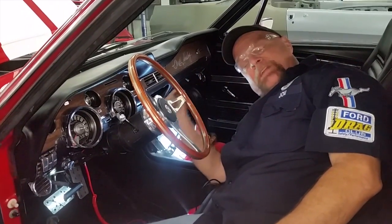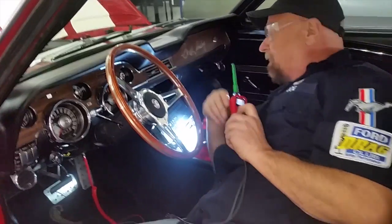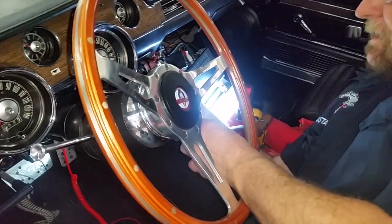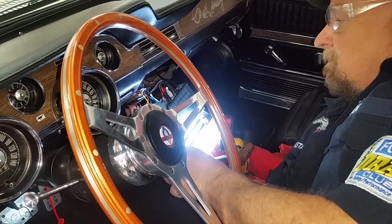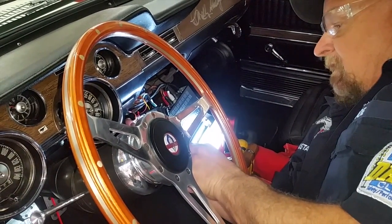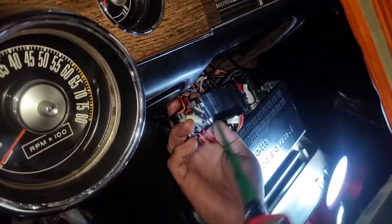I've been doing a little bit of checking in here. I got my power probe, which actually tells you voltage and ground right there in the little meter. I go to this side of this noise suppressor and I got 12 volts coming in. And then when I go over to this side, I got nothing. The fuse is good. When the key's on, I got 12 volts — well, about 10 because the battery's a little low. There it goes — 11 volts, 10 volts. So there's something going on on that circuit board on that noise suppressor. It comes in one side and goes out the other, but I don't have enough voltage coming out of this side.